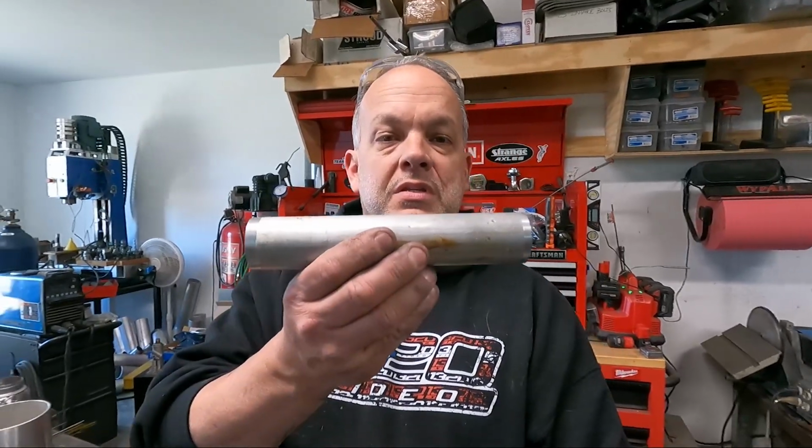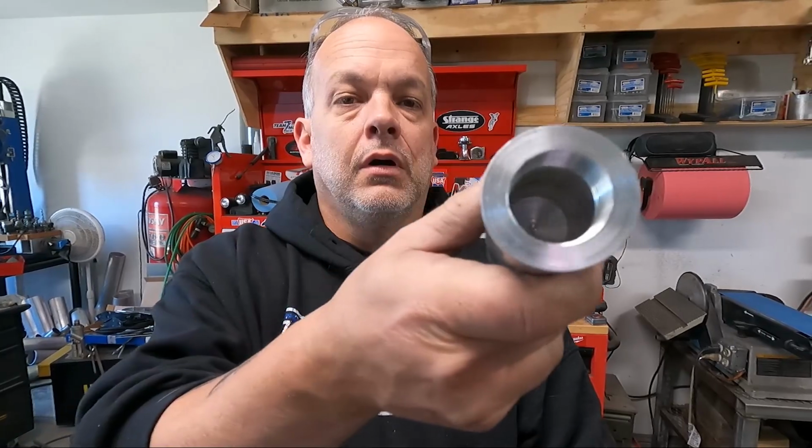So whenever I make stuff like this, I have pieces of material like this, and as you can see, it is already drilled and tapped on both ends. Certain kinds of material or certain sizes I keep pre-drilled and usually threaded, except for pipe threads. Since they're tapered, you can't thread them beyond the working length. So anyways, I keep these things threaded and already made because I do it so much, not necessarily for me, but for other people too. So all I got to do is just cut off a threaded part and it's already a bung.